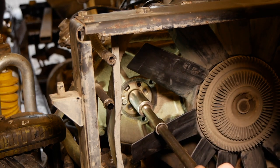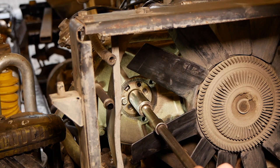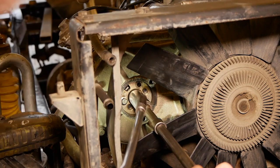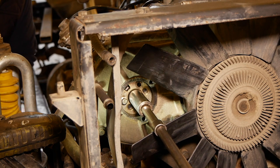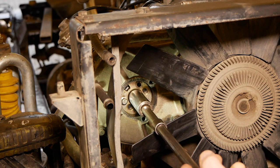Sit exactly there. Right, so Chris is going to come round here now and, before you tighten it up, just check what that gauge says. It's the slightest bit of movement I've got on this, it just winds in really quick. Yep. And what's it saying now? Oh, not bad. 1.52. I would be happy to leave it at that. It'd be good to have a third person to keep track of it while... But that's just as it's taking the tension back up.